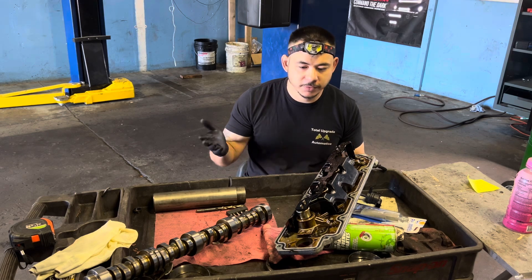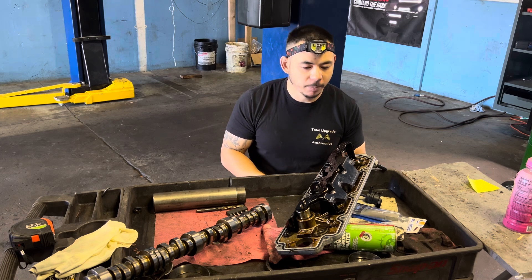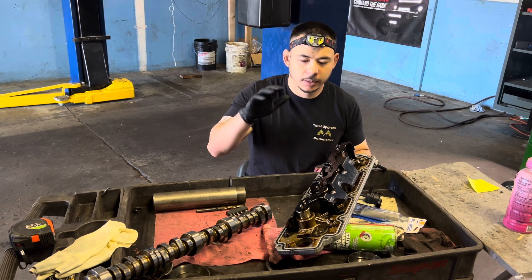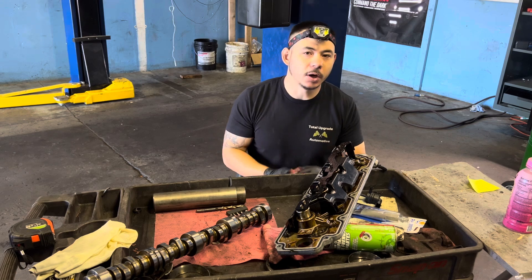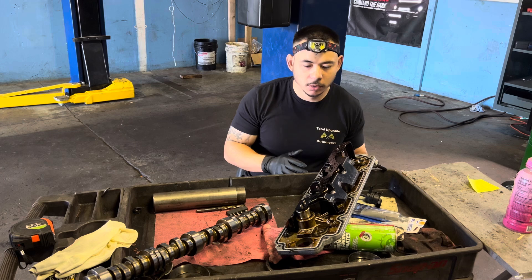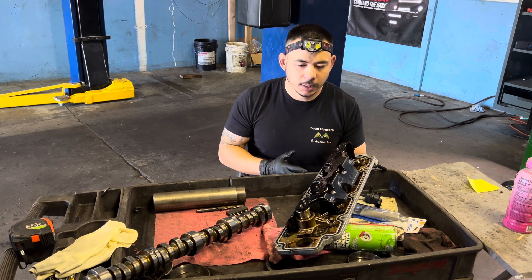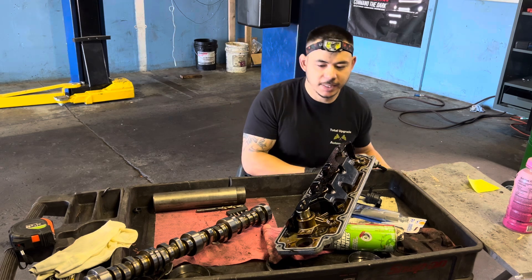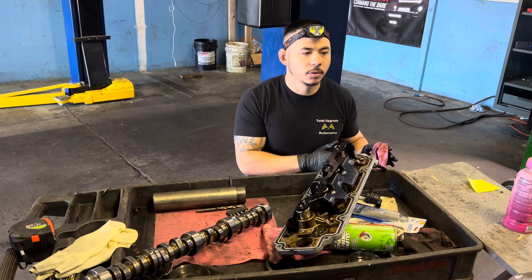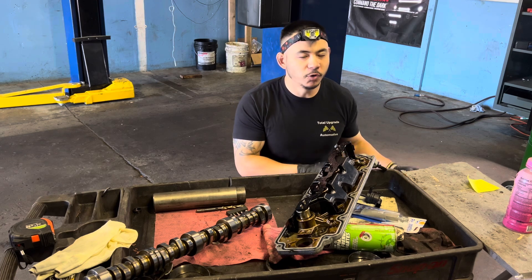On the highway, when the cylinder deactivation system disabled four of the cylinders, it started misfiring. It ran absolutely perfect for about 15 minutes during warm-up, then we noticed cylinder seven — on the other side, the driver's side of the vehicle — was misfiring. We took the valve cover off to do the test.